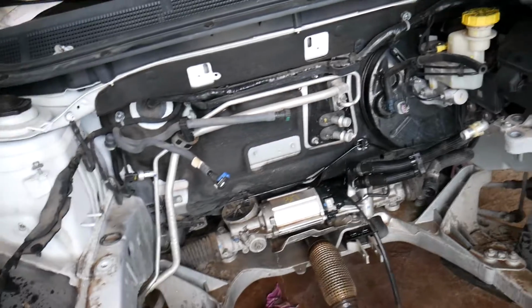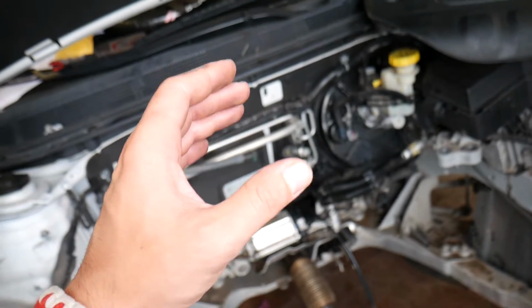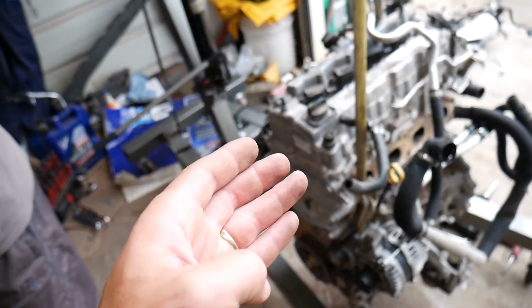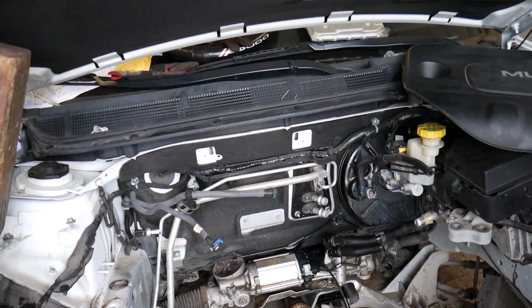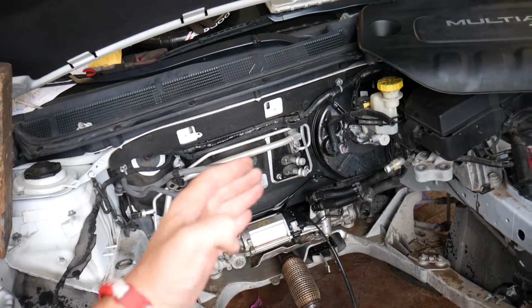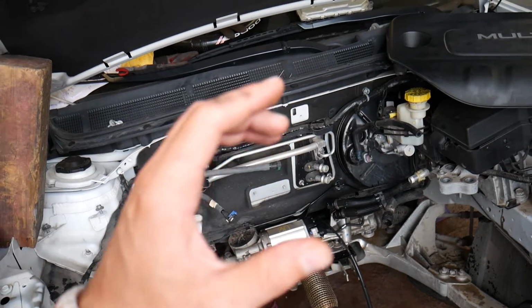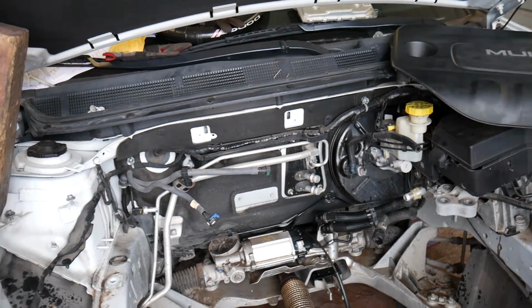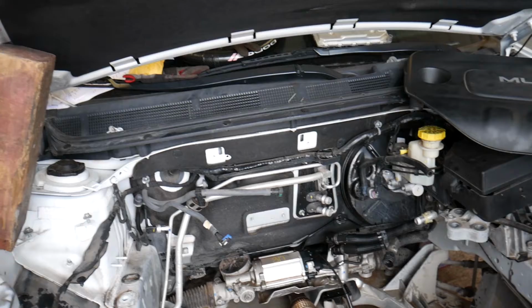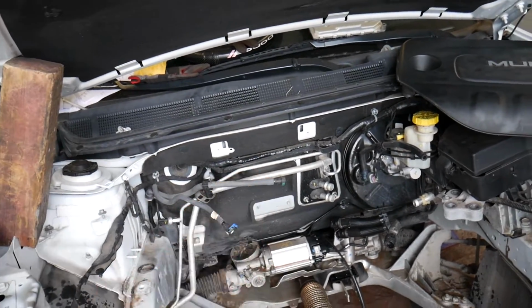You may notice when yours is plugged up, kind of like a whitish powder coming off of it, especially because it's aluminum. The engine's aluminum, on most cars the cylinder head is aluminum, so there is some kind of oxidation in the coolant that builds up in the heater core. This is because most modern vehicles have powerful engines, so they don't turn the engine so fast when you cruise down the highway. Let's say you're turning them at about 1500 to 2000 RPMs, and the coolant is flowing a little bit slower. And on older, higher mileage vehicles, especially if the coolant hasn't been flushed, you can plug up your heater.